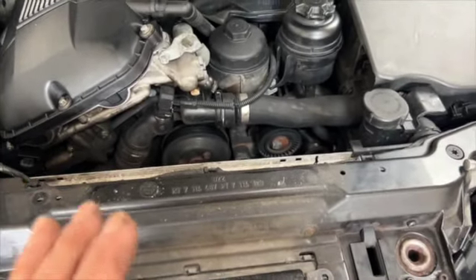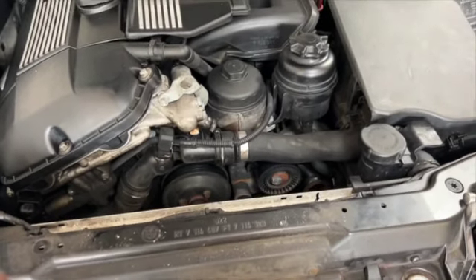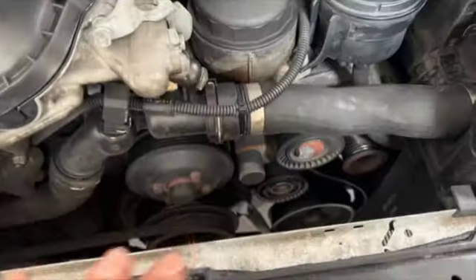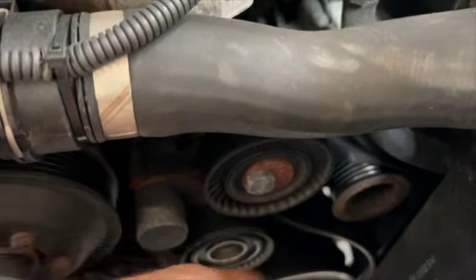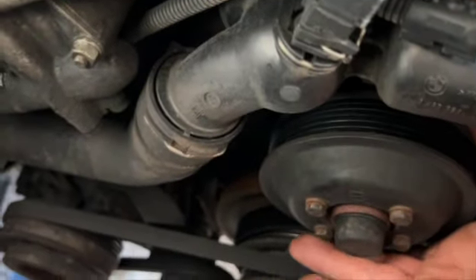It's hard to work out which pulley is faulty with the belt on, so what I always say is remove the belt and get it out of the way, which I've done here. With the belt out of the way you can check every single pulley — give the power steering pump a little wiggle, spin the tensioners, idlers, and alternator. But what we're really looking at, and I kind of knew this was going to be the problem, is the water pump.